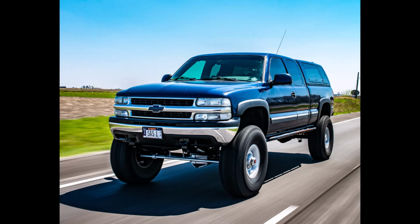And it's an LS pan, so of course it doesn't leak, right? Let you know there's oil still in it. Well, it's when it stops leaking. Time for another story: it did start leaking, but it's because I smashed it on a rock. And that's when I went to the Firebird pan. But the downside of the Firebird pan is it's shallow, so on real steep climbs we lose oil pressure. So, might go back to the truck pan, might put a baffle in it. We'll see. Dry sump? No. If anything, like what are they?